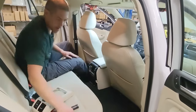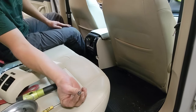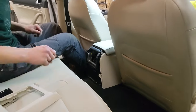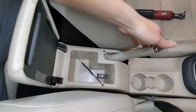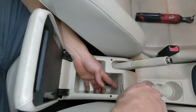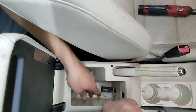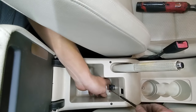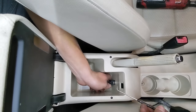Next, you're going to have a T20 Torx screw. All the fasteners on this job are T20 Torx, but there's a T20 Torx screw here and one on the other side here, just mirror imaging. Then we'll lift this lid and get this parking brake really, really high, and we'll pop this cover back here. There'll be a T20 securing it, and then we'll need to bring this auxiliary input rearward, get the top first, and then reach from below with your 90-degree pick.